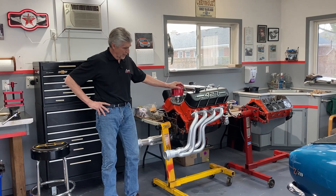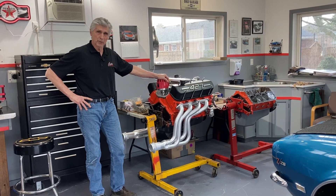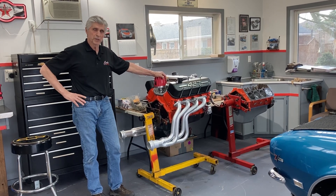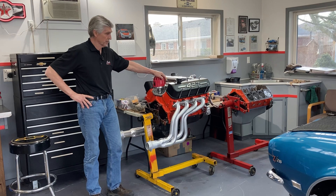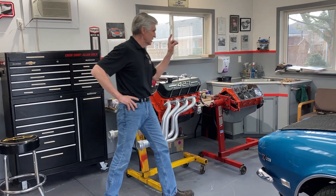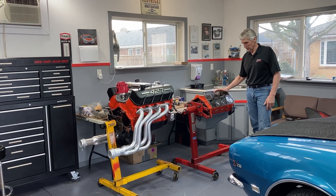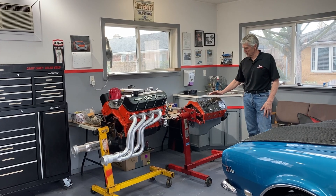Before we wrap up, take one last look at this gorgeous engine — it's going into an El Camino next week, so that'll be a project and I'll try to make videos about it. If you've never put a big block where a small block used to be, watch my channel — I'll have a list of all the things you have to change that you might not have thought of, like the brake booster, because the valve cover won't fit under the stock brake booster. This is one of my 400s — actually a 406. I sold this engine; a gentleman named Pete DeMello purchased it and it's going into an S10, which should make it spin the tires pretty good.